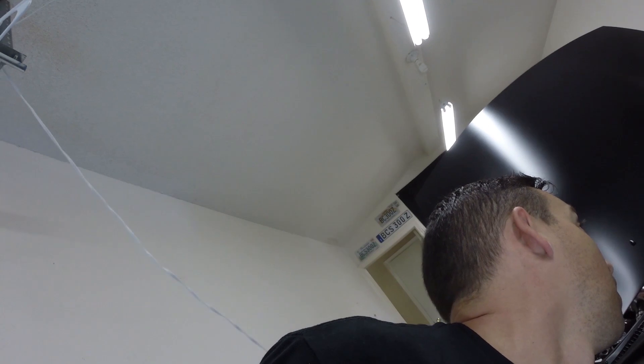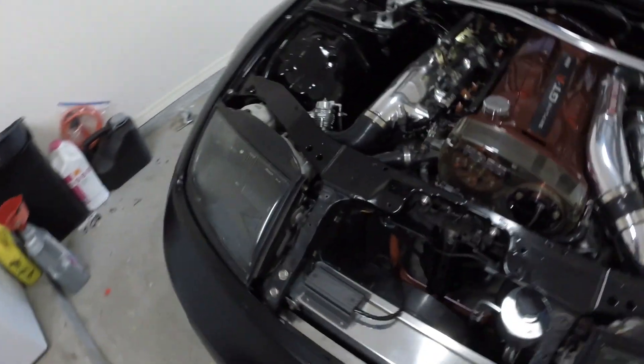And the fan is off. The fan has stopped — that's great, it works. So now I just need to figure out the way to install that override just in case of emergencies. Worst case scenario, if I can't get the Haltech to do it, I'm just going to wire right into my fog light switch since I don't have fog lights anymore, and I'll just be able to click it on when I notice the car is getting too hot. Now officially — super success. Intelligent fan control. I'll talk to you later, bye-bye.